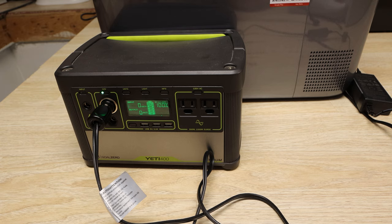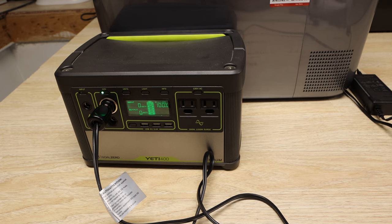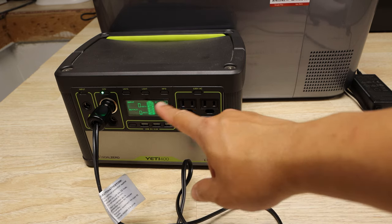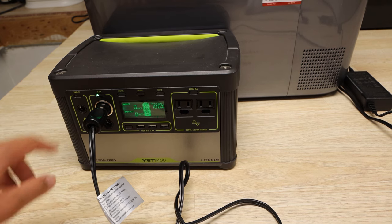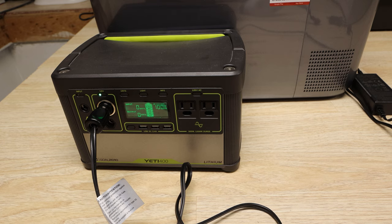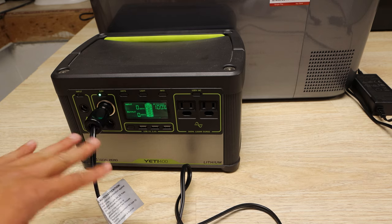Now taking into account how you plan to power this inside your car — obviously if you're at home you're going to be using the 120-volt adapter that comes with the unit. But when you're in your car, I highly recommend: do not use the primary battery. Use a secondary battery or a power station. How I would typically run this setup is I would stick the 12-volt plug onto a Goal Zero power station and use a car charger on that side to power it. That way as the refrigerator is on, it would be constantly charging, and once you kill the power on your car it stops charging, but your fridge freezer would still continue to work.